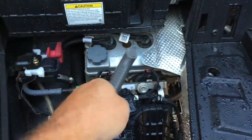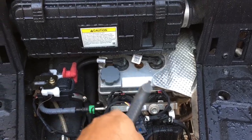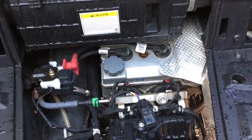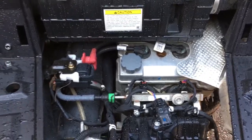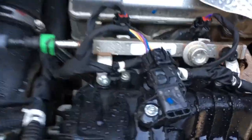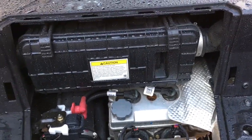So, same thing. I won't make a lot of noise in the video here, but just lightly blow them out, okay? Lightly blow them out. Treat compressed air similar to how you would a pressure washer. Believe it or not, even if you don't pressure wash, you just use a hose. If I was to take compressed air and really blow around some of these sensors, I can blow water in with the compressed air. So treat it with care too, okay?